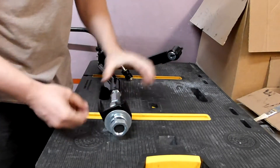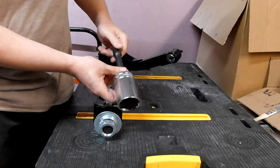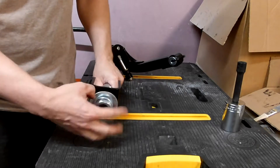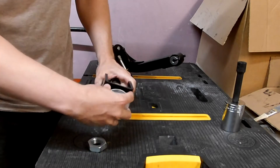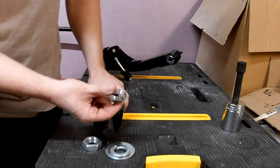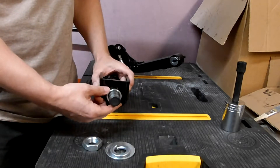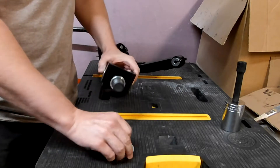This is the strut rod piece, and it comes with a one and a half inch nut on the front of it, so you have to make sure you have that socket if you're installing this. The one and a half inch nut has a lock washer and a regular washer, but there's also this bushing that centers the front assembly part of the lower control arm into the strut rod brace on your car. You've got to make sure you have that shim to keep the strut arm part of this centered.